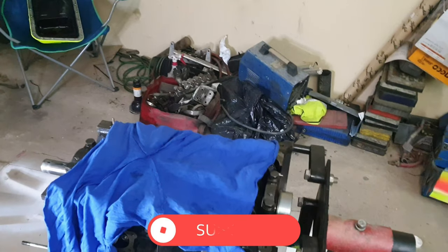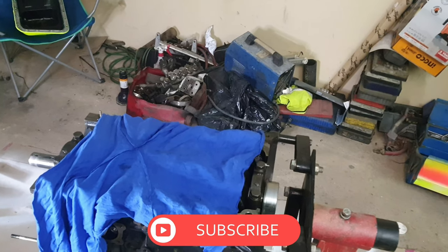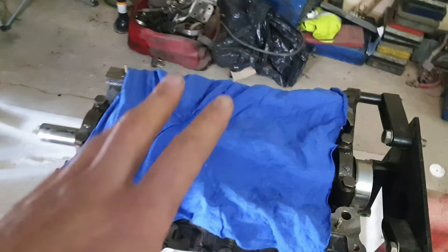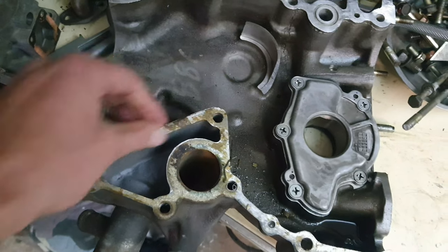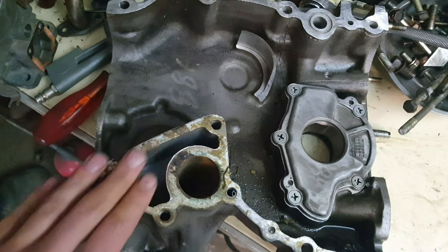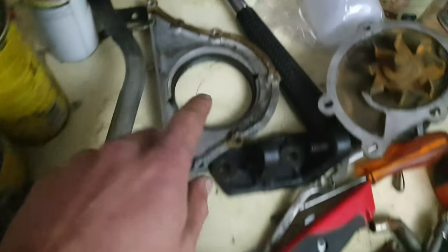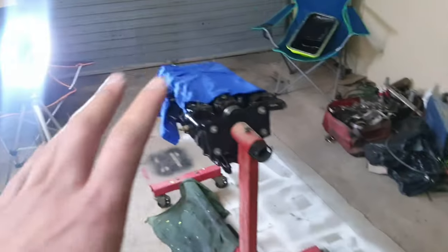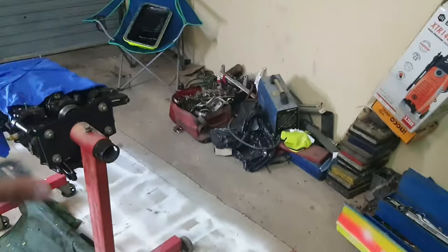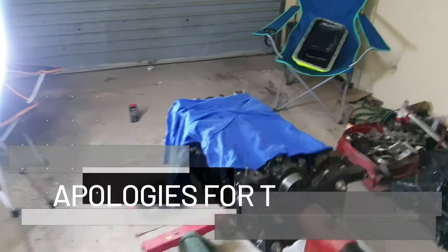So we're finally done with torquing the connecting rods as well as the main bearings. That's done now. So meanwhile, I'm going to start here by cleaning up this old gasket, clean everything, as well as this side, so that once this is done, we can put it back, as well as the sump with the oil pickup. And then once that's done, then we can basically put everything together.